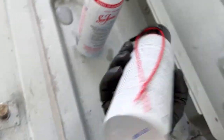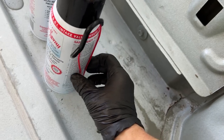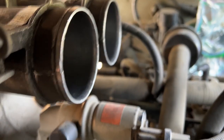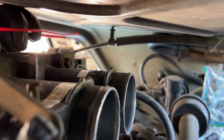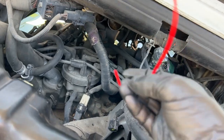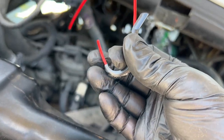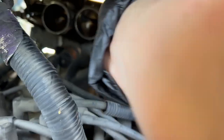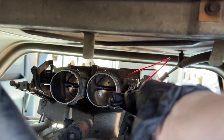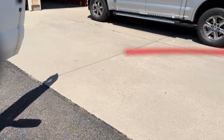However, I'm going to prepare the seafoam — I got just two bottles of it here because it's such a big engine. It comes with a straw and this little loop thing. What I'm going to do is when I install the rear hoses that go to the throttle body, I'm going to place a hose in each one and not tighten them down fully yet. So I'm basically going to move this up so there's just a little bit left, and install it there so I can get to the rear of the hose in the back.